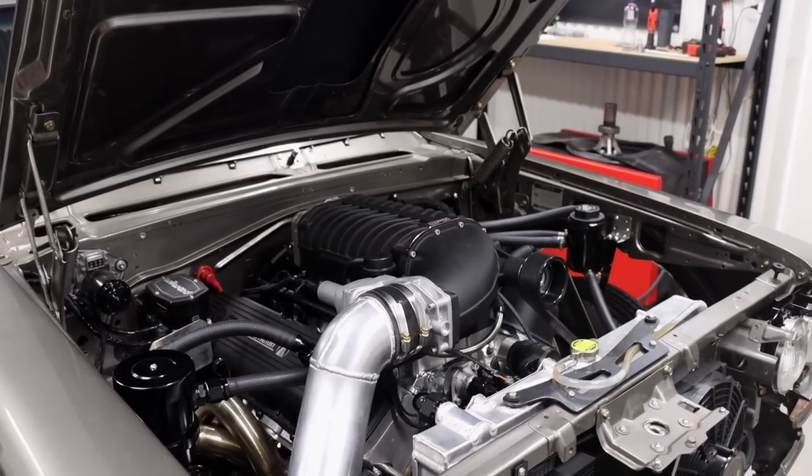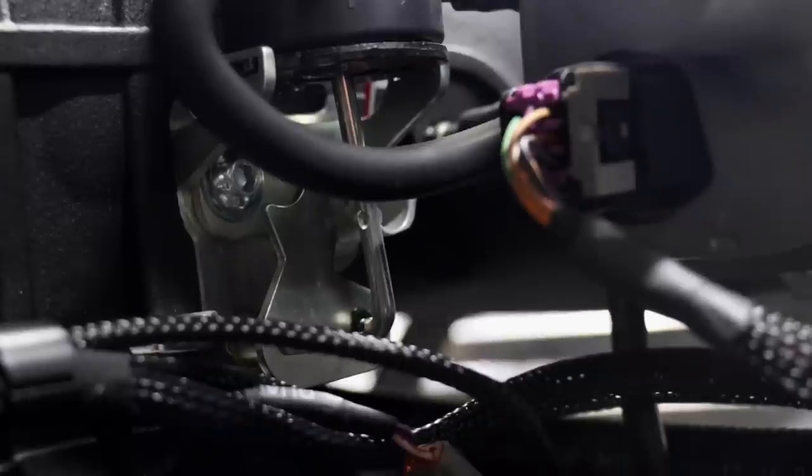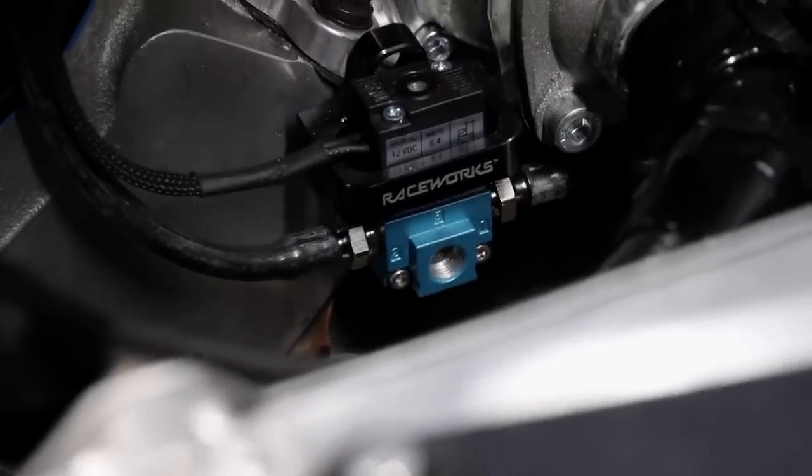One other potential option we have, which is rather unique to this car, is the fact it's drive-by-wire, and the fact that we hooked up the boost bypass. So we are just toying with the idea, because obviously it has to get to Gussie's formal. So we're just trying to get an interim solution. Obviously the right solution is to put a fuel system in it suitable for the engine, but an interim solution may be we can limit the maximum drive-by-wire throttle angle, which will take boost out of the car, and we could play around with the boost bypass to just get something that at least can be driven around, have a little bit of fun with for the interim.